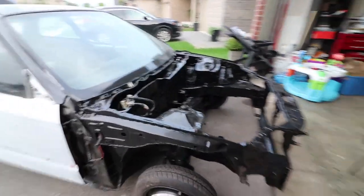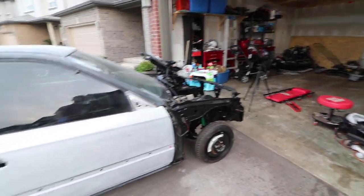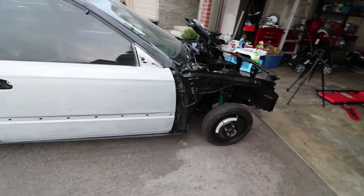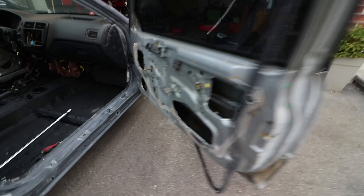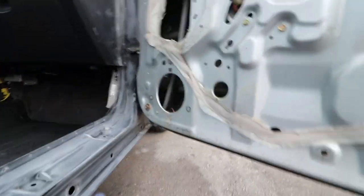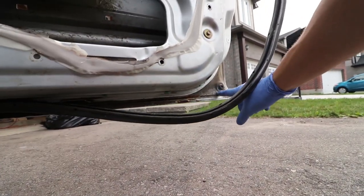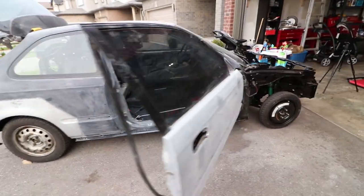Welcome back for another episode. I've gone ahead and removed the front fenders already. Next thing to take off is these doors, so I'm gonna remove the top and bottom hardware and finish up prepping the rest of the door jams. There's still a lot of sanding to do in this area, and I still have to hit up the bottoms of these doors — there are a couple minor rust spots. I need to get everything prepped properly before I throw that epoxy primer on, so stay tuned.